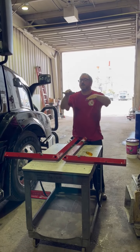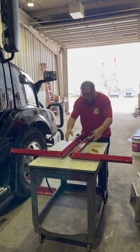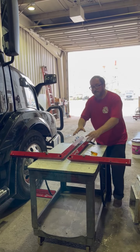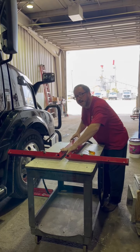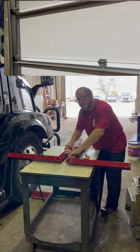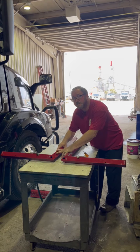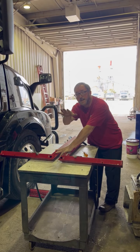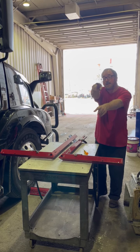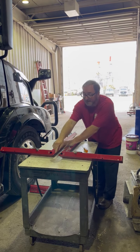Here we're talking about thrust calibration if you don't have the cabinet that's in the QCT video. Let's say we have here a typical shop cart with a typical — you can see it's a gouged, dented plastic cover. Is this a proper calibration surface? Well, there's a way to test and find out. Hold the tube horizontal, bars down, and slide them side to side on the surface, making sure that the laser stays steady. If it does, your calibration surface is valid. Once you've got them set, you want to make sure that both lasers are the same height off the floor. I didn't check whether or not this is level or whether it's the same height as the lasers up on the wall. All I care about is: do both of these lasers point toward and away from the calibration surface equally?